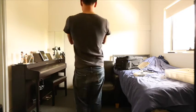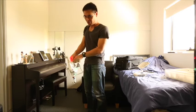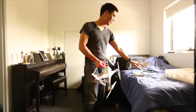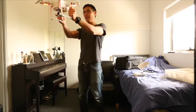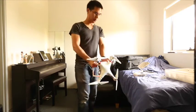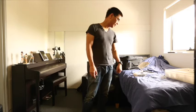Then you do what I call the drone dance. You do a full 360-degree rotation holding the drone horizontally. You'll notice the two green lights flash — that's step one complete. Then it asks you to hold it down facing the camera toward the ground, and you do the 360 rotation again. If it flashes red, you didn't do it right and need to start over. Once you get green lights on both steps, you're calibrated and ready to take off.